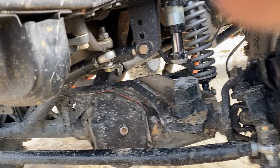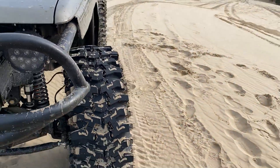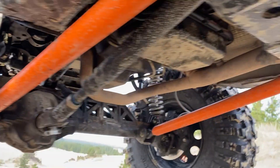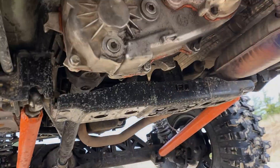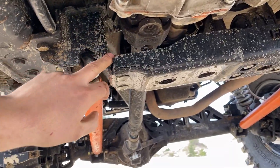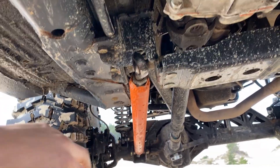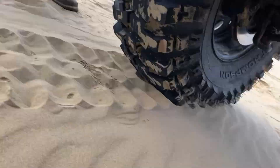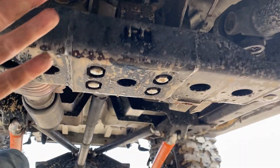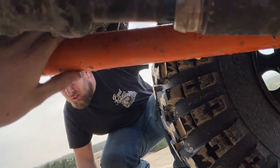This is a three-link up front, all nice two-inch quarter-wall tubing. Some sort of hydro assist coming around. This is the Iron Rock link mount crossmember — same that I had. Actually, your front's different. That's the actual Iron Rock three-link crossmember, not the critical path one meant for radius arms. So if anyone out there is building the ZJ, I highly recommend this crossmember — it's a way better crossmember, super beefy. Two-inch quarter wall.